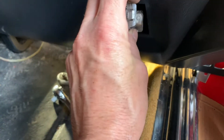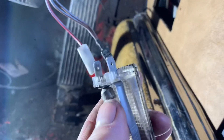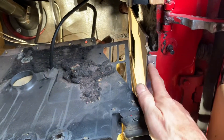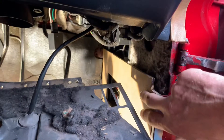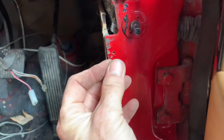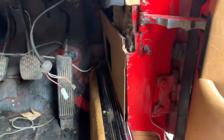Just remember which screws go where - these two are both the same. On this car there's one 10mm bolt. Gently let that down and you should be able to take that rubber grommet out and unplug that light. These lights are clipped in at the top - just unclip it and feed it through the hole, then pull those spade connectors off. To give myself slightly better access, I'm going to take this trim piece off as well.